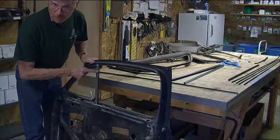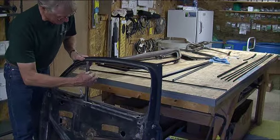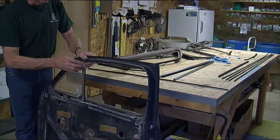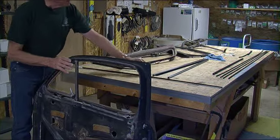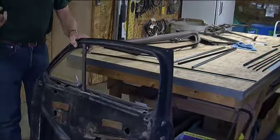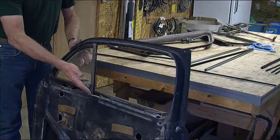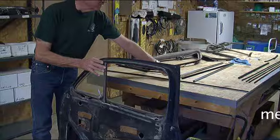This is a '50 — you can notice there's no bead. I stress this because people will say, 'I've got a '50 Mercury, so I need a channel kit for a '50.' I'll send them one and they'll call back saying it doesn't work. These cars are 60-plus years old — who knows if the door has been changed, or maybe a '51 vent window assembly has been put into a '50 door. It works just fine and bolts right in, everything's fine, except our channel kit won't fit if you don't have the correct year.